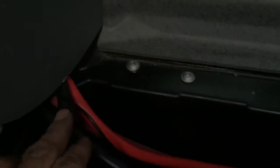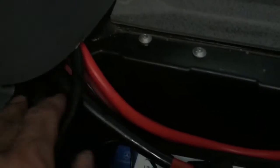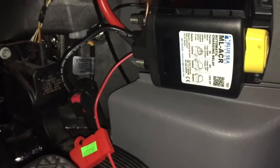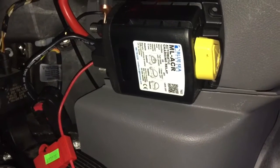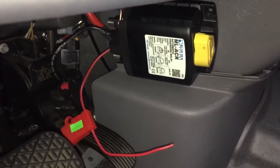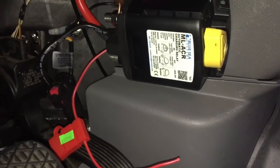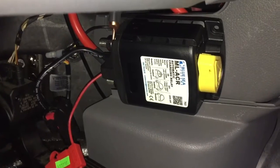As you can see here, all the power cords run under here. It's going to get a little tight so you have to make sure you add some extra protection to these wires in case a little bit of pressure is applied. Here's the ground wire — we ended up connecting it to this nut here. And here is the charging relay right underneath, where it's easily accessible. Having a charging relay is a must if you're going to be boondocking and want to charge your batteries while driving, or on long extended trips, so you're not draining your auxiliary batteries without a way to recharge them.